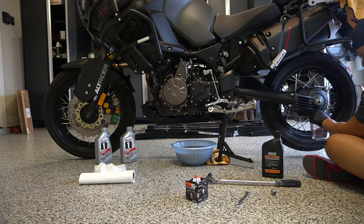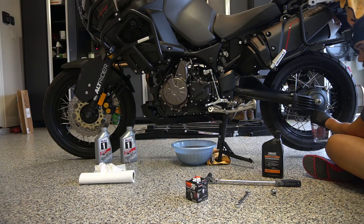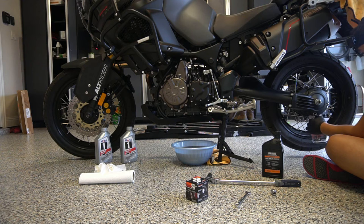And you always want to check the magnet to see if there's any shavings. See, I bought this bike recently used, and the dealership tells you, hey, we changed all the fluids, but I don't really believe them. I never believe the dealers, even when it comes to my own vehicles. But you want to drain this and check it, and look at this, this is disgusting. I mean, this is bad. So you can see how thick this fluid is and how many shavings.